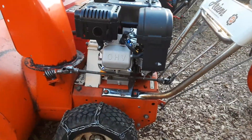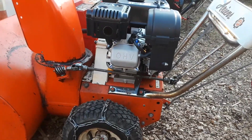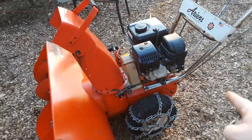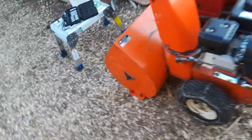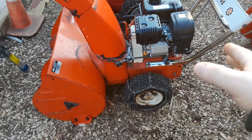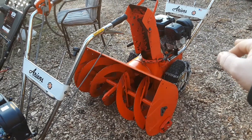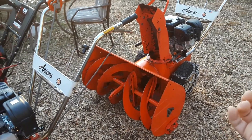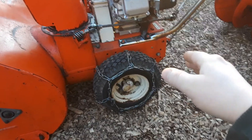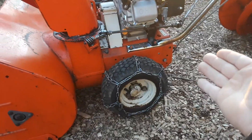As most people know, these engines are capable of running at 4400 RPM safely for many years. This engine's three years old — been running it at 4400 on this machine commercially with no issues. This engine I just bought and installed, and that's the one thing I noticed: with the stock carburetor, this one runs a little bit rougher up at 4400, whereas the other runs a little bit smoother with the stock carb jet. Even with the adjustable, running above 4400, this one will still run a little rougher, but once you get to 4400 RPM and under, it runs perfectly smooth with this adjustable main jet.